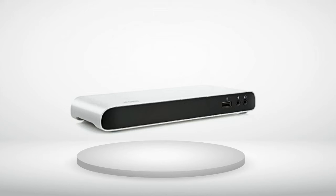If you take your MacBook Pro on the road, this clever little box makes it so that you only need to connect the Thunderbolt cable and the MagSafe power cord when you get home. Your monitor, spare/backup drives, peripherals, wired network, all connect to the dock. The dock also offers a wonderful side benefit to owners of pre-Haswell MacBook Pros, 2011 models, which were equipped with a Thunderbolt port but only slow USB 2.0 ports. The USB 3.0 ports on the Thunderbolt 2 dock are fully functional on these models as well.